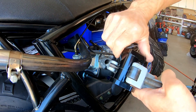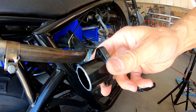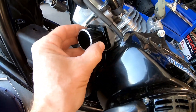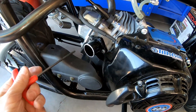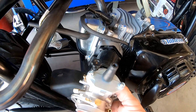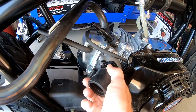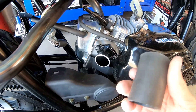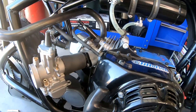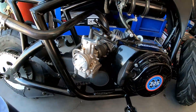You can still use the VM22 on it afterwards — just use the tube in the middle if you want. I'll pop this end on here, making sure I get it the right way. The piece the carb came with is a little bit too short for this application because it hits the chain guard. That's an easy fix — I can use this longer piece I have, just a little bit longer, to kick it out far enough. I'll throw some clamps on, nice and tight, and it clears everything.